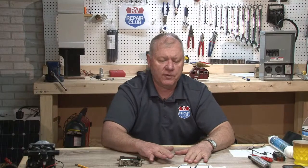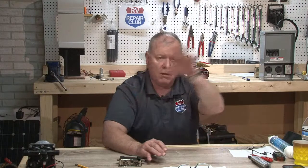Get that top piece conditioned. If it's rubber, get the rubber conditioner from Dicor. The next thing I would recommend is that you periodically check the seams in your canvas, because you've got stitching all around that keeps those panels in, and that can dry out and start to deteriorate. It'll leak. It'll break. They do make a seam sealer that you can put in there.